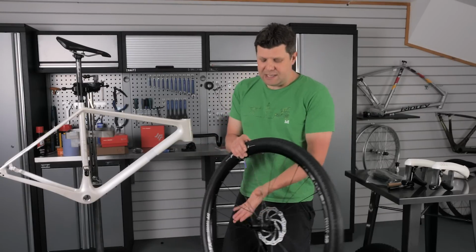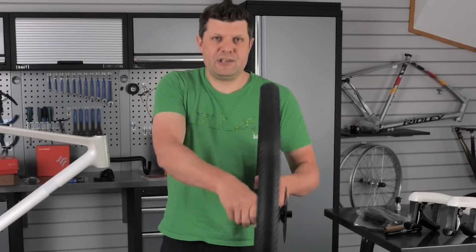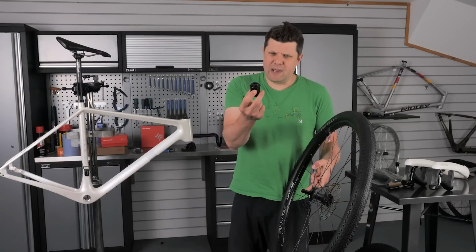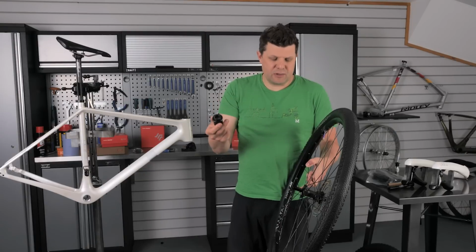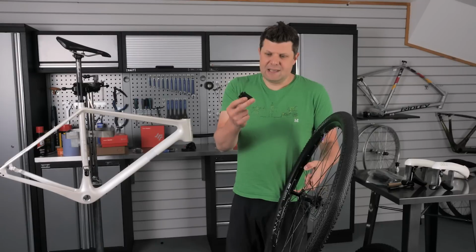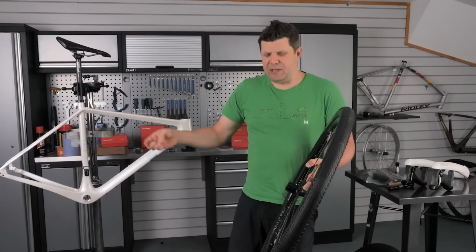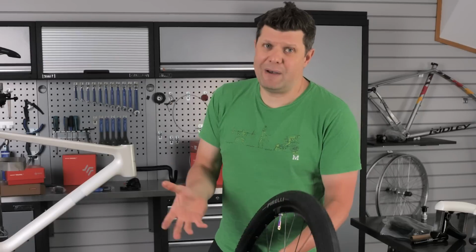The decision we do have to make is the wheels currently have a Shimano Hyperglide. Now this uses the DT Swiss pawl system. You find this on their OEM hubs rather than their 350s, 240s, the ones that you buy aftermarket, which have the ratchet. But you can still buy these freehubs. In fact, we have, because I can't make my mind up what gear ratios to run. You see, we planned this build before SRAM came out with the Apex upgrade. So now we have a decision to make.